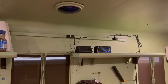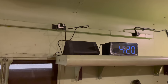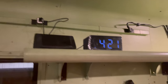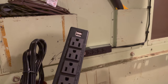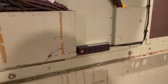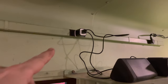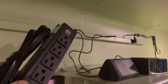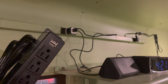In a small vehicle like this, all of your power ports are in high demand. Instead of using up an AC power outlet for USB, I've now mounted one of these combo outlets that has USB and power outlets built in, down here by the bed. That way I don't have to tie up one of my good outlets with a USB adapter. Adding a few of these power strips into your build can be really helpful to get more outlets without wasting them on USB power.